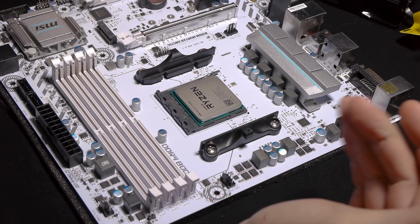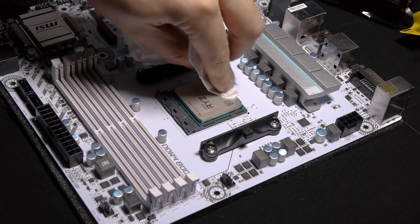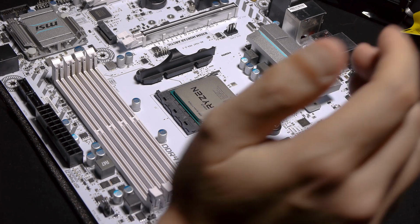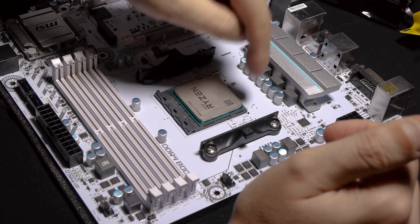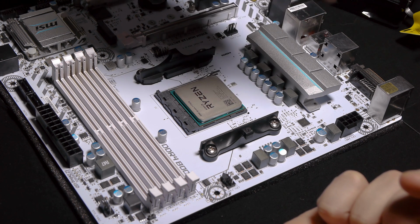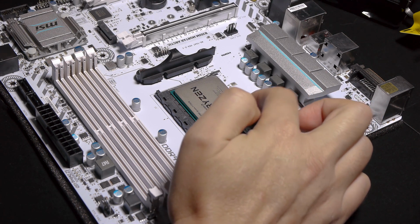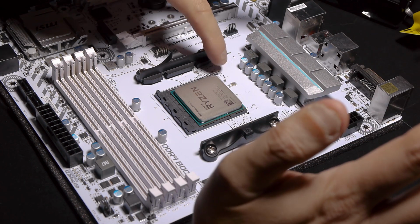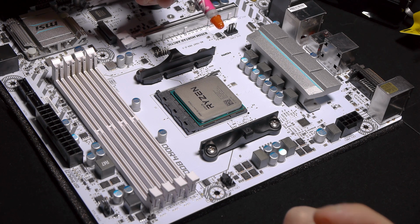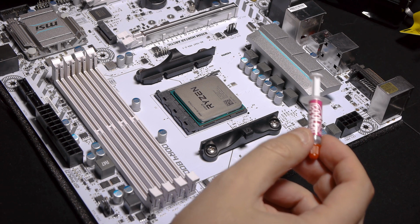So once you have placed your processor and you have cleaned it with a little bit of rubbing alcohol, medical alcohol, not drinking alcohol, and it's in place with obviously the consideration of the little silver triangle there going to the indication on the mount itself. So in the good position and lock position, you're going to apply the thermal paste, which is provided in our case. I'm going to use the provided thermal paste.